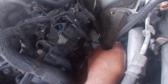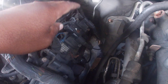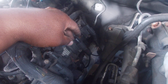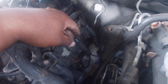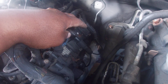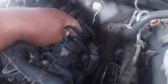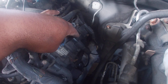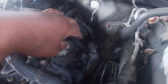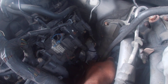So if you're going to do a tune-up, do the wire and the spark plug at least. Now, these coil packs last pretty long. If you have a misfire, you can tell if it is your coil pack because the misfire would be so bad — the cylinder isn't even getting enough voltage or amperage. Whereas a misfire from the wire or the spark plug itself is going to be a little more subtle.